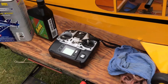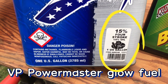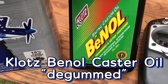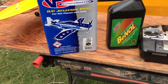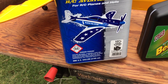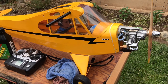I'm going to get it fueled up. For the fuel I'm using VP Power Master — I purchased this without looking at it in detail, but it says 14% oil and 15% nitro. I actually increased the oil content by adding some castor oil. I don't have my calc sheet with me, but I did calculate it, and by doing that I dropped the nitro content down probably a few percent. Basically this is running about 18% oil now with probably around 13 or 14% nitro. So now I'll get it fueled up, get everything set up with a tachometer, and we'll get this thing started.